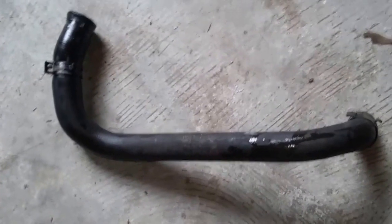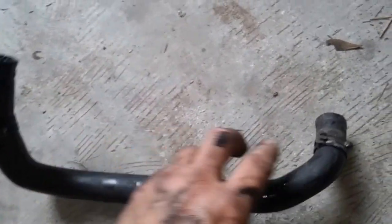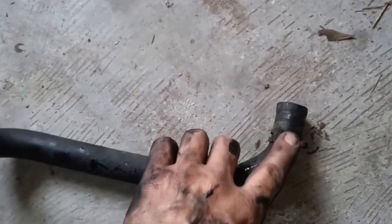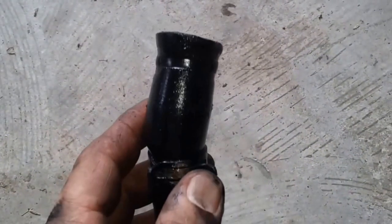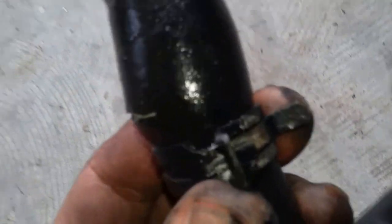Now this is the actual hose that I took off of it. Over here where you could normally see the hose — where it goes into the heater core — it's fine. You follow it up here, and up here where it goes into the spot you can't see, is where the tear is — the actual hole. This had been leaking for a while; it probably started out really small, which is even harder to find, and then it finally got big enough to where you still had to have a pressure tester to find it.